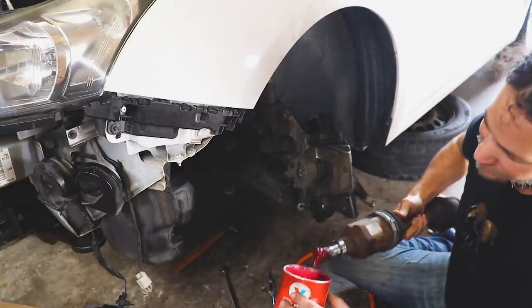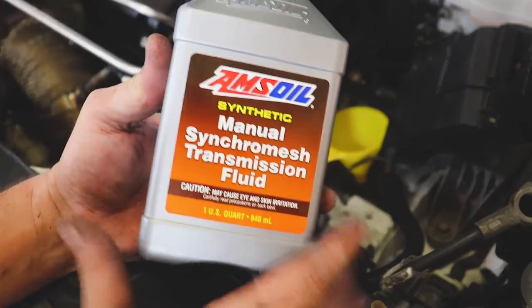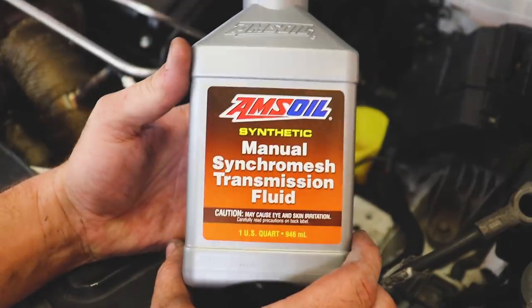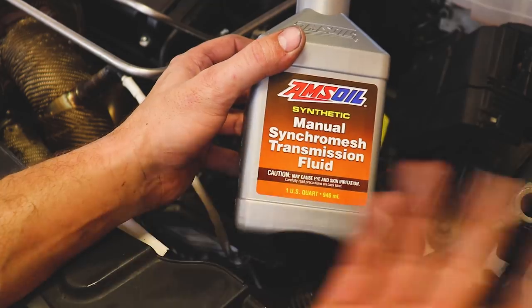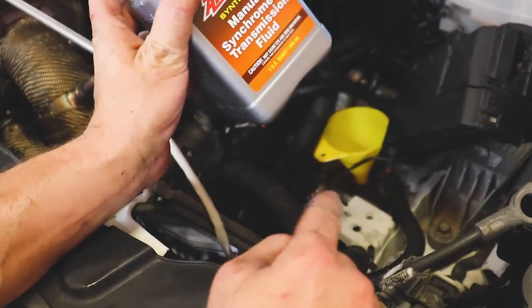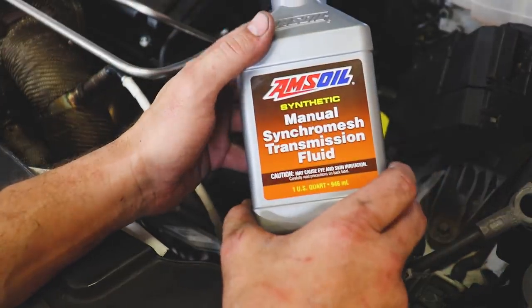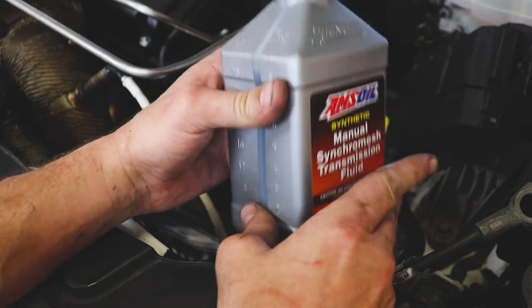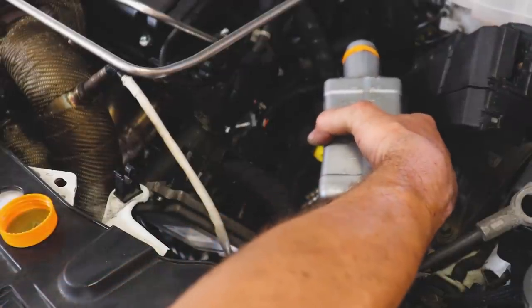Let's stab in our axles and put a little high-temp grease in — this is some of the best stuff for these M32 transmissions, helps with that first-to-second gear grind by slowing the synchros down. It's well known these transmissions are a little underfilled from the factory. We'll put in 2.2 to 2.4 quarts as an overfill instead of the factory 1.8. Let's toss it in — see if I can't not spill anything.